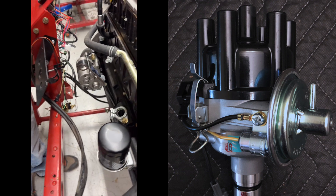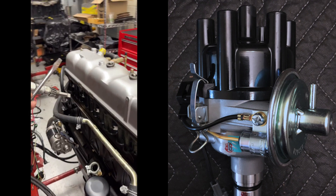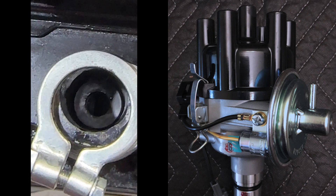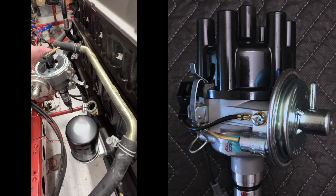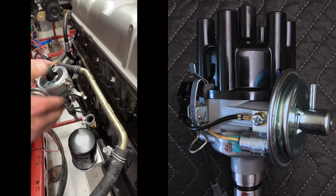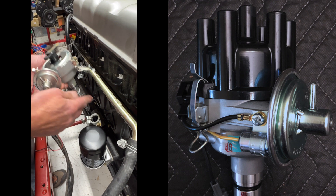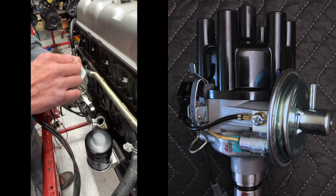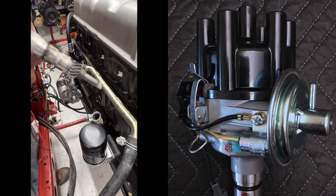I like to get my screwdriver basically perpendicular to the camshaft centerline — so 12 to 6 o'clock, straight up and down. I like to put the distributor about 30 to 35 degrees off. If it gets stabbed correctly and everything meshes right and the clip is close, after it goes all the way in you'll never get the cap off. So we want to organize the distributor and find number one — this is a gear catching and turning as it goes in. We're going to start off to the right, pointing between two and three.